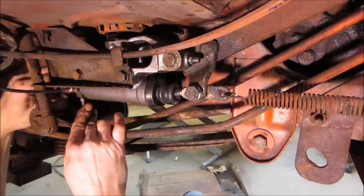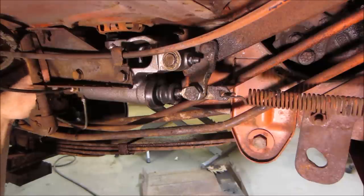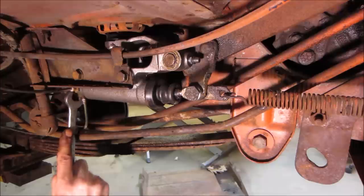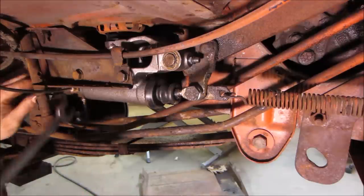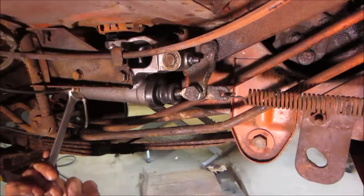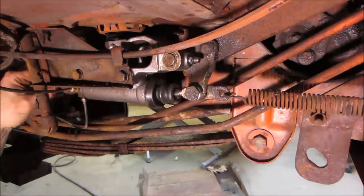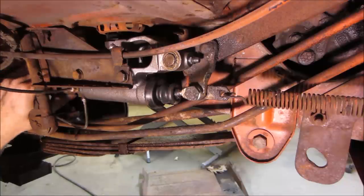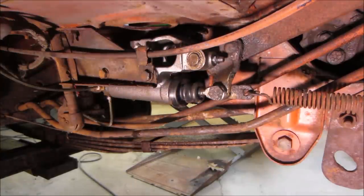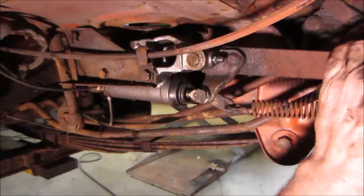That's like, there's your problem. The odds that brake switch is going to be doing good. Brake lights. Those two wires back on. And we, oh, with some brake fluid. We got to tighten that up yet, right? Yeah. For sake of conversation, yes, you're supposed to bleed from the furthest to the closest. So I opened the floor up, filled the master up. We got you. Pressurize it from down below.